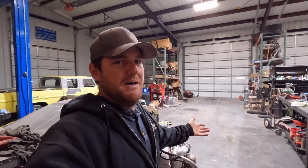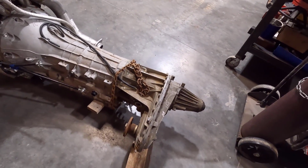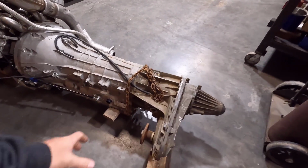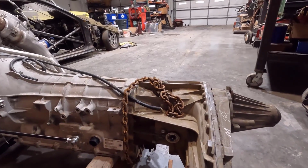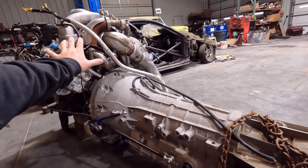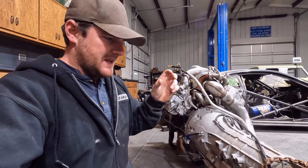I'm not going to be putting a ton of miles on this thing, so hopefully that CP4 is all right. I'm not sure what I'm doing on the transfer case right now. I initially wanted to do electronic shift, which is what this one is. It has an electric motor here, but there's a module that controls that and the locking rear end that this truck had, or that frame had. But the only problem is the computer I'm using to control this was out of the ambulance, and it was two-wheel drive, so no transfer case and no locking rear end, so it didn't have that module. So I don't have any of the wiring for that module, and the plugs.